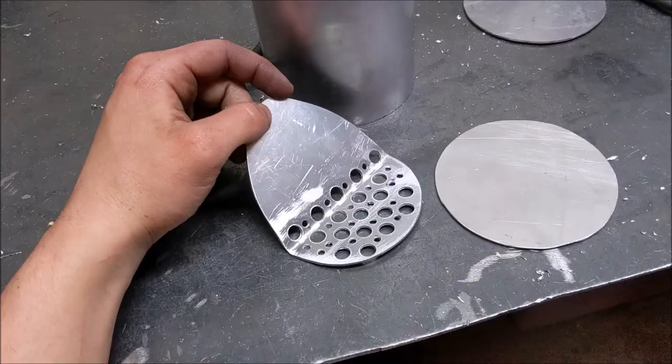I'll also put a baffle on the bottom, not all the way touching the bottom but just down far enough to prevent too much sloshing. The race car has to compete for extended periods — five, six-plus hours minimum, sometimes closer to 19 hours — so it has to be able to hold a decent amount of oil or at least go through two-hour stints before it needs to be drained.